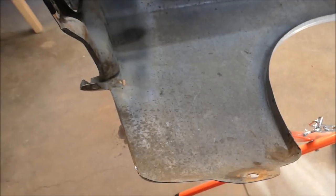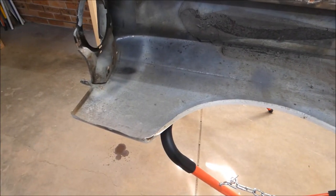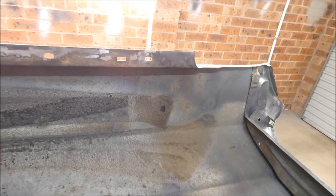I'm just going to go through the process of cleaning up every little thing. There's lots of things that some guys might not think about when they go through this process, but I'll show you what I do to try and be as thorough as I can. One of the first things I like to do is scrape up these insides. They don't have a guard liner like a modern-day car, so anything that the tire grabs and flicks up — fresh tar and stuff like that — gets stuck onto the guard. I tend to just scrape them, other than the factory deadening they spray on. I don't like to disturb that, especially if there's no rust showing under it. Just leave it be.